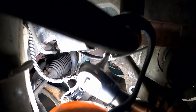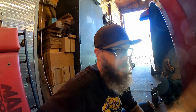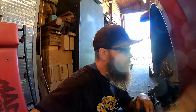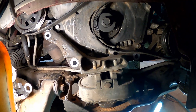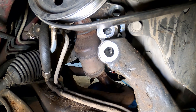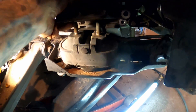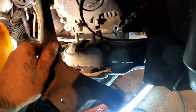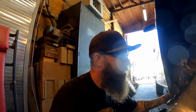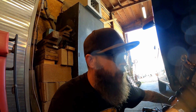This last bolt is tucked in kind of under the power steering. I've got the engine supported by the jack and the last bolt is out. Let's see if we can wiggle this mount out - raise the engine up just a bit to get that bracket wedged out from behind the power steering pump. There we go, just like that. I think I can wiggle this off now. With the mount out of the way, we can lower our jack and let the engine hang from our rigged-up bar up top.